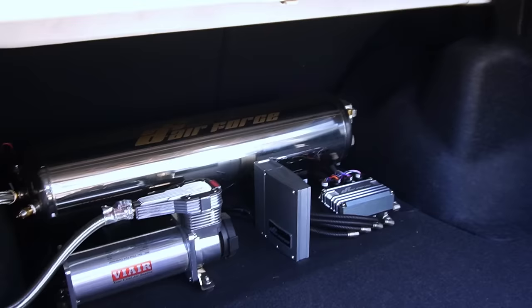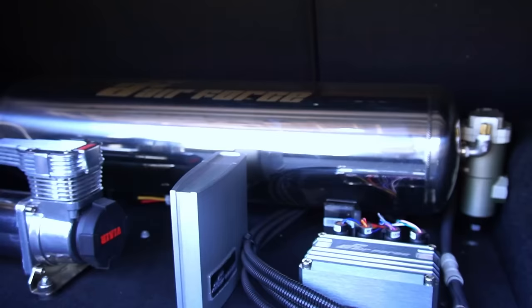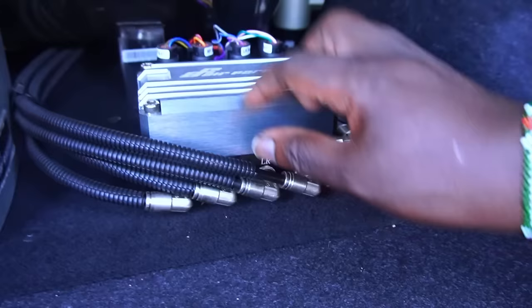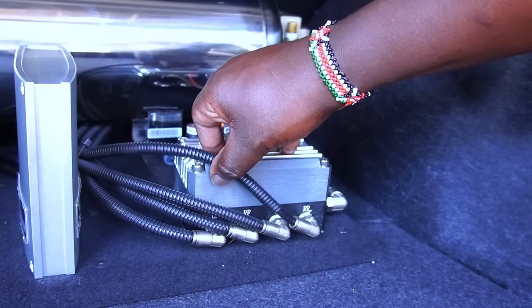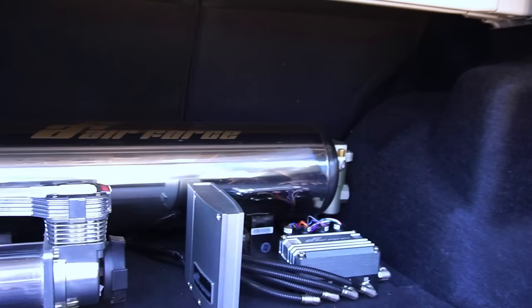For those who are curious, in your air suspension setup, this is where you have the compressor and the control units. This is rear right, this is left rear. Then we have left front and right front. Funny enough, on somebody like Machete's setup, the Airlift suspension, the ECU and the control unit are connected, like one unit. So this is quite a new setup to me.